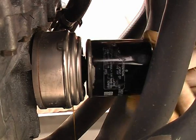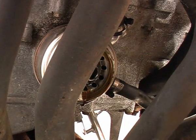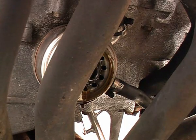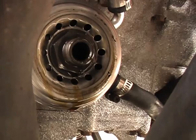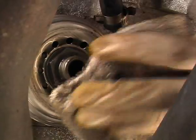On bikes with vertical filters this will be especially so. In this case the oil filter is mounted on the oil cooler takeoff ring and it will continue to drip for hours. But as I don't have that much time, I'll give it a quick wipe over and install a new filter.